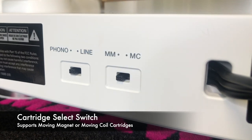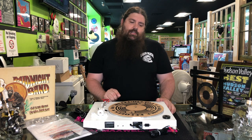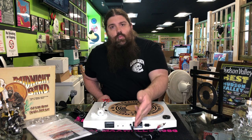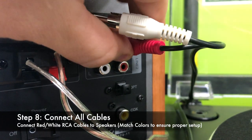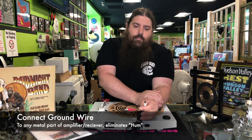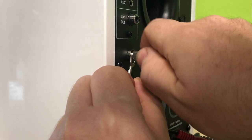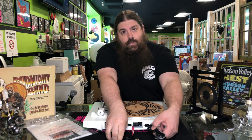This switch here is your selection for moving magnet or moving coil cartridge. The majority of cartridges, including the one included on the LP3, is a moving magnet cartridge. Moving coil cartridges are very expensive with very low output and honestly beyond this turntable, but Audio-Technica has included the option just in case. For the purposes of this setup, please make sure you are on the moving magnet setting. Now, the hardwired phono cable — aka RCA cable, aka interconnect — the red and white is what you'll use to connect to the back of your receiver or powered speakers. Also includes a ground wire: most receivers or powered speakers include a terminal for this, but if not, connect it to any metal screw on the back and that is enough to ground the table. Then go ahead and plug in the power cord.